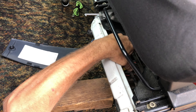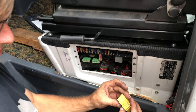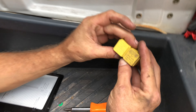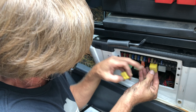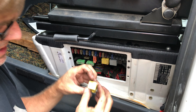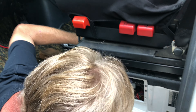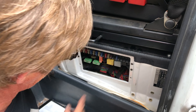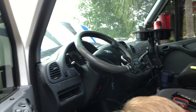That relay kicks the fuel pump on when it works. Sometimes your first relay will be over here - they don't all have this. I'm going to pull that relay out, make sure it's the same as this one, and swap them. I'll put the possibly bad one from the back into the front slot and this known-good one into the fuel pump slot. If this fixes my problem I'll order a new one, but this will keep the van running for now. And we test.